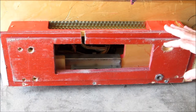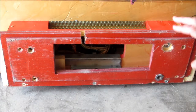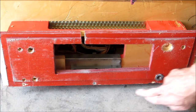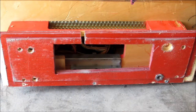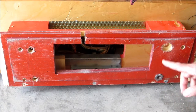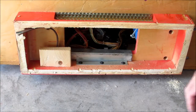Here's the backbox with that modified piece of cabinet. You can see there's only one t-nut here. What happened is the t-nuts were falling out - rather than replace them, it looks like they tried something with regular nuts, that didn't work, so they put screws in mounting the backbox to this board and jammed it into the frame. I'm going to take these screws out, find some replacement t-nuts, and maybe put some wood putty or superglue in to hold them.